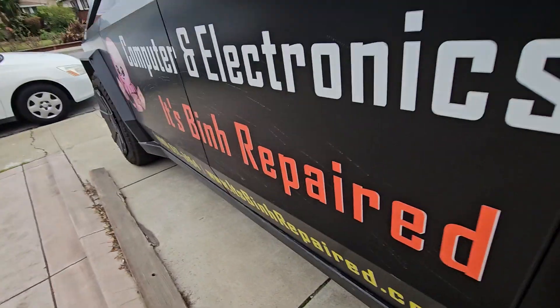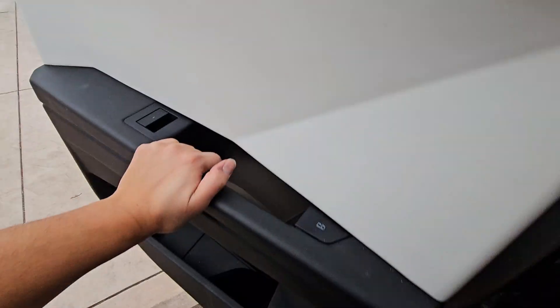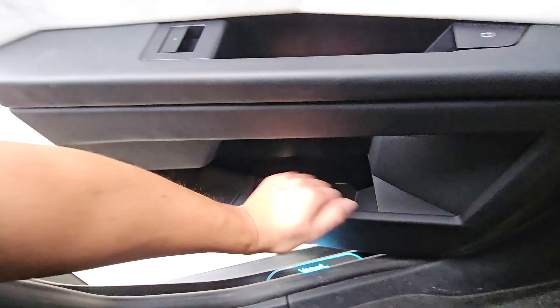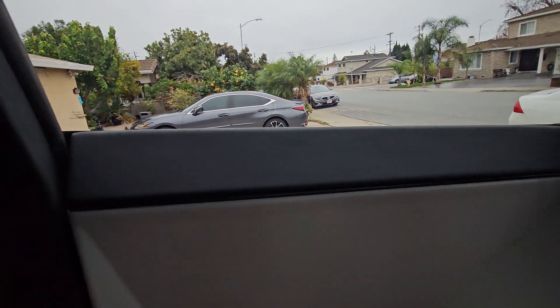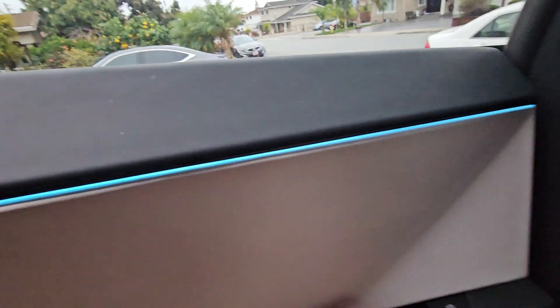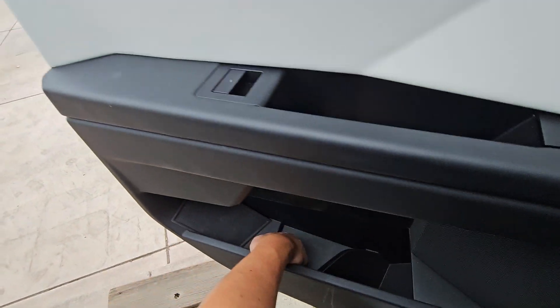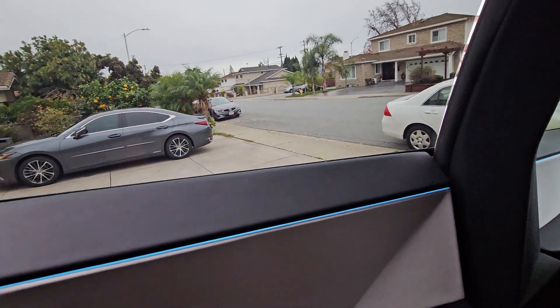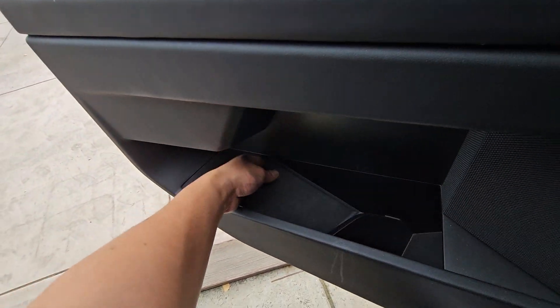Now what about the rear passengers? If you don't know how the car works, you're going to be like, 'where is it? There's no handle here.' But down here there's this little rubber piece — set that aside. You see this yellow? You just pull on that and there you go, the door opens. Pull on that yellow thing and then you can push the door out with your elbow. You do want to have your window rolled down a little bit, because that can cause some damage. But usually if there's power to the car, it'll actually also roll down the window automatically — if I pull the yellow thing, you can see it rolls the window down.